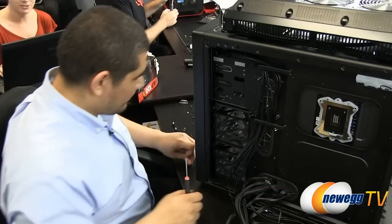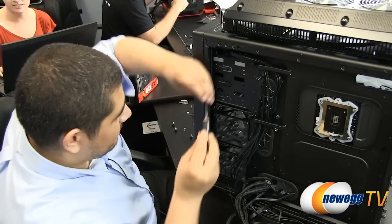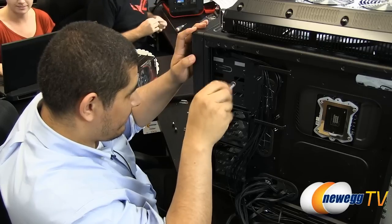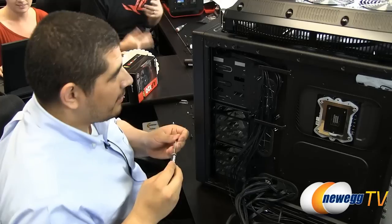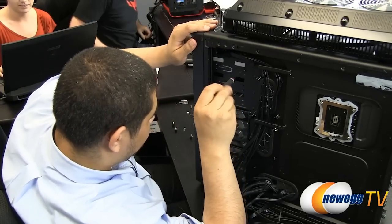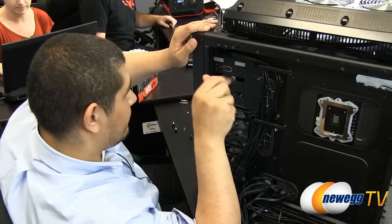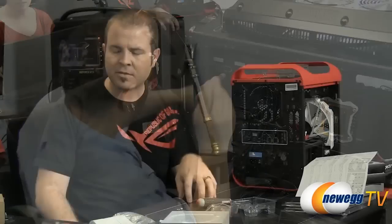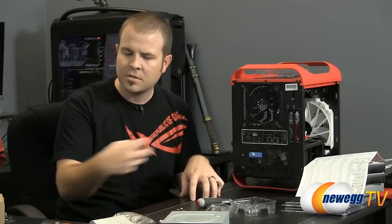Sorry, what? Should I overclock my RAM? It's already running at 1600 megahertz. No. He says no. If your kit is rated to 1600 megahertz, then you can play around with it a little bit. But effectively, for most stuff you're going to do with a computer, at least from my experience and what I've read so far, the most effective use case right now for a home PC for overclocked RAM is if you're using something like an AMD APU and you're using integrated graphics, because that will give you a pretty significant boost in your graphics performance. But I would disagree, Paul.